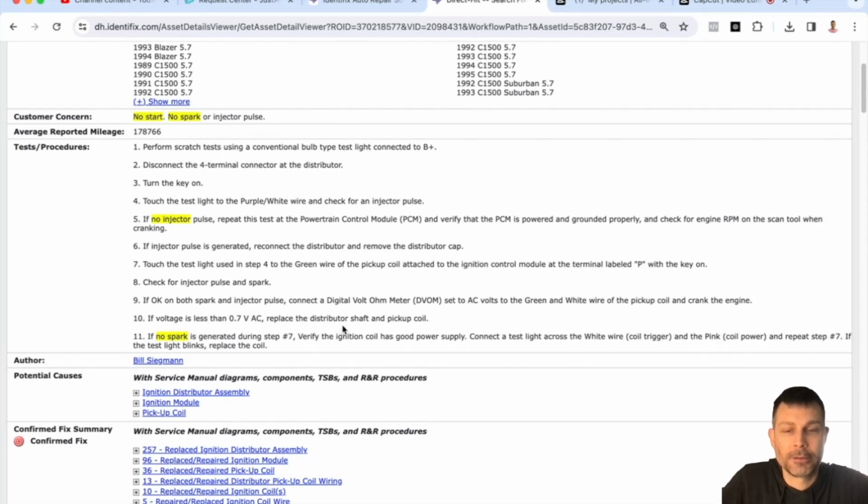Okay. Yes, sir. And then if it doesn't spark there, I go to the distributor and see if it sparks at the coil. I would just go to the coil first, see if there's power at the coil. Or you can even do that first before even checking for spark. It's up to you. Okay, so unplug the coil wire from the coil and do the same thing. Put a spark plug in it and see if it has spark.